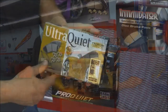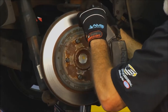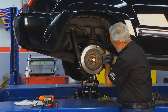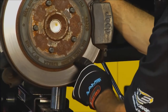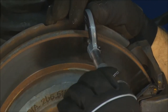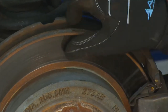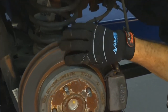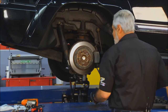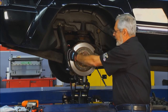You've got your pads here and we've got our liners here. What I'm doing now is I'm measuring the thickness of this disc with the micrometer right here in the front. We've got minimum thickness 12.5 millimeters. I measured it in a few different places. This is a pretty smooth rotor, so a flat mic's working good. Most disc brake micrometers will have a pointed anvil. This is measuring 13.1, 13.2, but it's got a lip on the outside edge where the pad doesn't ride. There's not a lot of miles on this Jeep, but the people let it sit a lot.